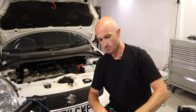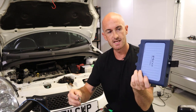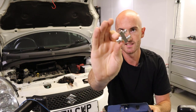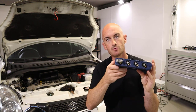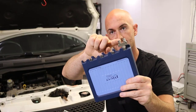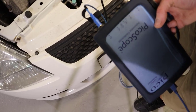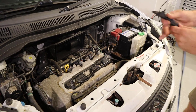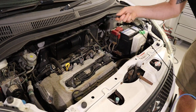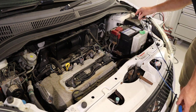If you've got an oscilloscope with floating grounds like the 4425A, you can use one of these little BNC splitters, which will allow you to connect onto that individual channel — one of the split leads goes to ground, and the other connects up the mixer lead. We've got the blue lead connected on channel D of this oscilloscope, and I'm connecting that to the ground on the negative terminal of the battery.